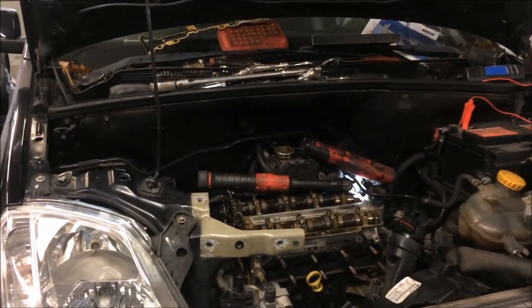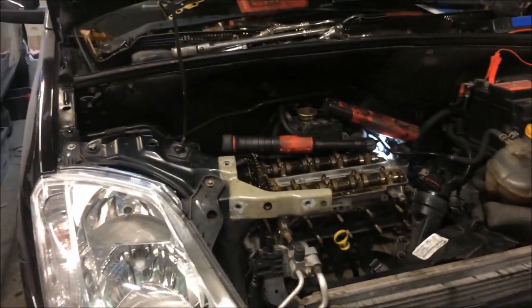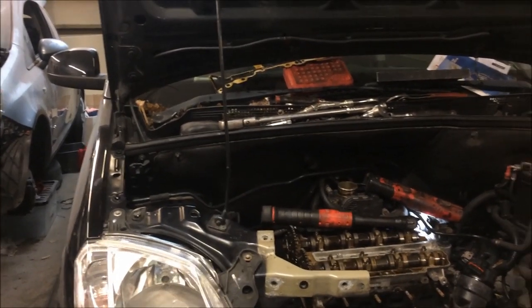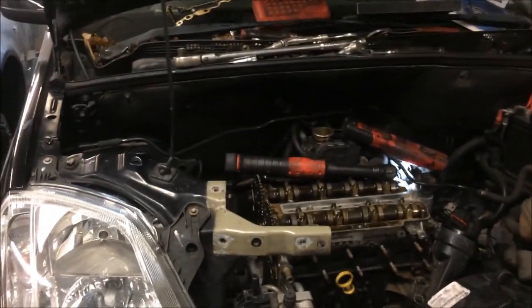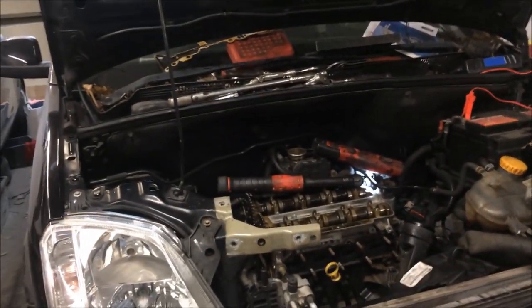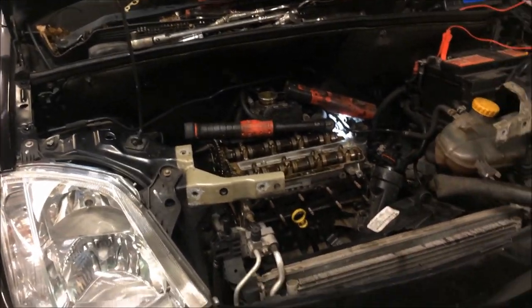I had a person say what information was in the Hyundai video — well, there's quite a bit, because not a lot of garages know there's a timing chain at the back of the cams. That always throws them when you get those Hyundai coupes in and they sound tappety. They start failing them on a top end rattle and low oil pressure, start coming out with loads of crap that just isn't true. It wants a new timing chain, a tensioner, and guides on the back of the cams — that usually fixes that one.